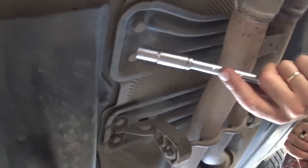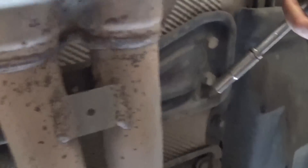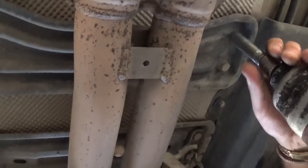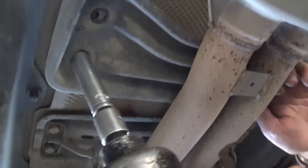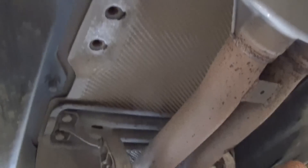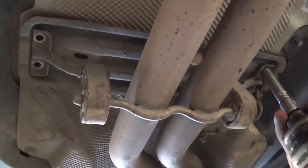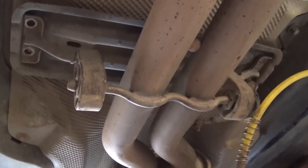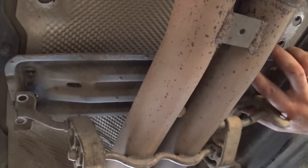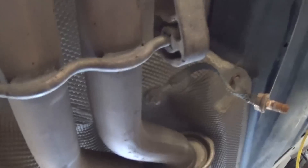Now we're in the middle of the vehicle and we need to remove these four bolts right here — there are four more on the other side. This is holding the exhaust up to the body. With a 13 millimeter socket you can just use a ratchet, take them all off. Now we can pull this metal plate out of there. Next we need to do the other four — two on this side and two on the other side. Be careful, the exhaust might drop a little bit. Now you can pull that metal plate out too, and we have one ground wire that we need to remove with it.